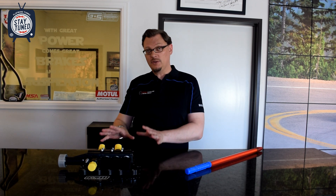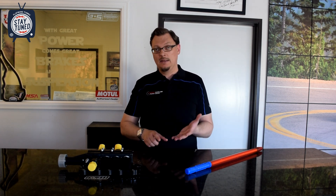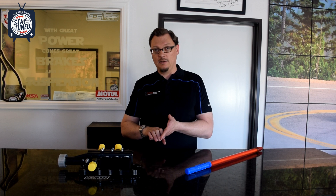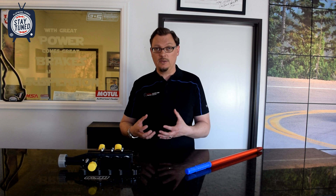In terms of the function of the dry sump, we've made a handful of videos about that already, so I'm not going to go into too much detail. But there are some key points about a dry sump in the discussion between that and an AccuSump. The biggest ones are: the dry sump eliminates the oil pan and the oil pickup, and it eliminates the stock oil pump, moving it off the crank so it's not directly driven by the crank.